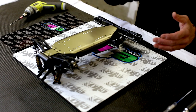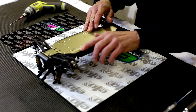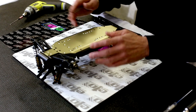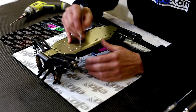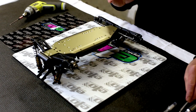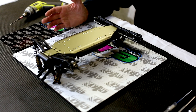So at this point, if your chassis isn't clean, you may have some dirt and debris in your hex heads. One of the keys to this is not having that problem in the future. So we want to make sure, before we put it on, that we get those all cleaned out. Using a small pick, you can make circular motions and pick all that dirt out, blow it out, and get those hex heads clean. That way, when you need to get to this chassis, it's not a problem in the future.